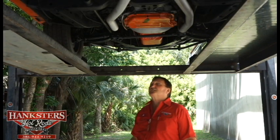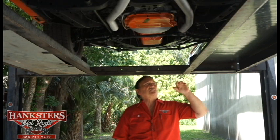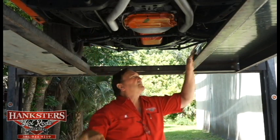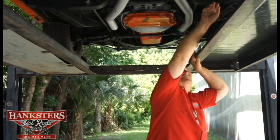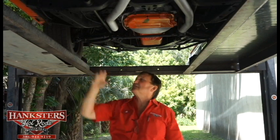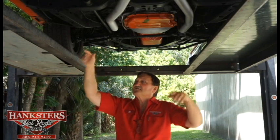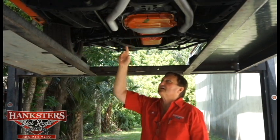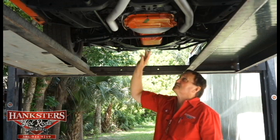Two-and-an-eighth inch pipes coming off the original cast iron exhaust manifolds. Sub-frames in the front are absolutely beautiful — very, very nice condition. I don't even see any lift marks or jack marks on them anywhere, other than a couple where someone put a jack stand. The sub-frames laterally don't have anything on them. Original floor pans and fender wells — floor pans transition over and you can see the spot welds where they're attached to the rocker panels. Original transmission cooling lines, 727 transmission — no leaks.